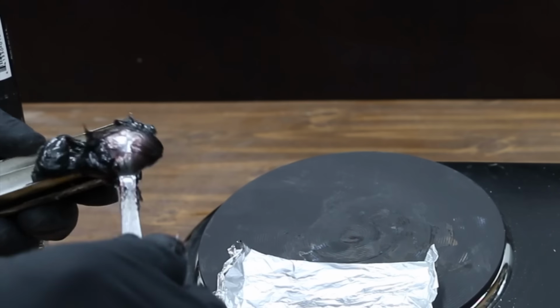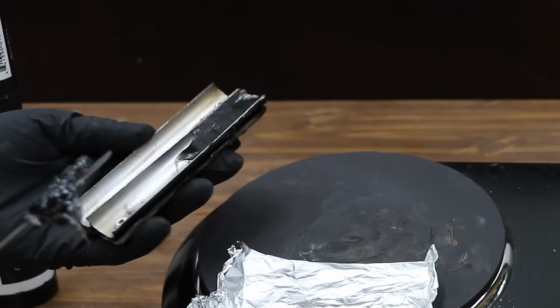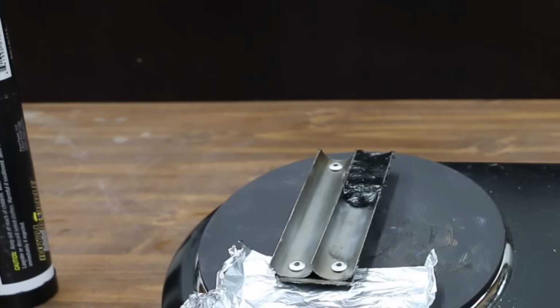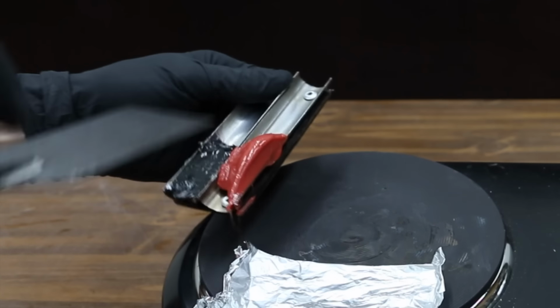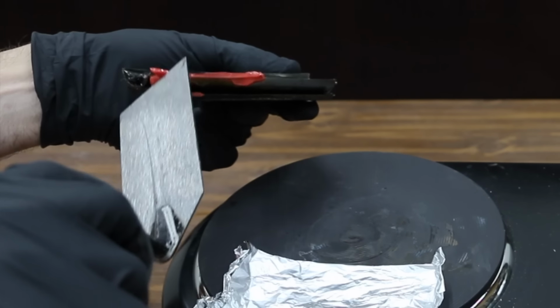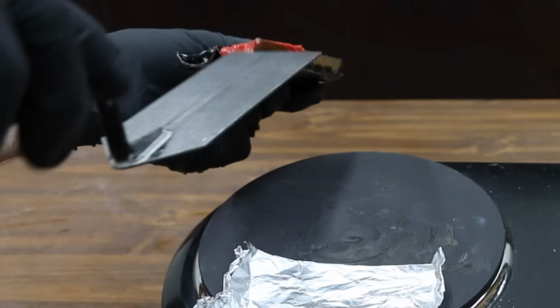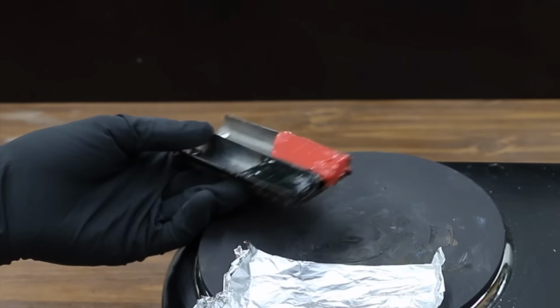A high quality grease should have a very good heat tolerance, and the official ASTM test for that measures the grease dropping point. I'll be applying approximately 25 milliliters of grease on each side of the grease slide. The dropping point of grease is the temperature at which it passes from a semi-solid to a liquid. It determines the cohesiveness of the oil and the thickener of the grease. A properly formed soap structure can withstand high temperatures.